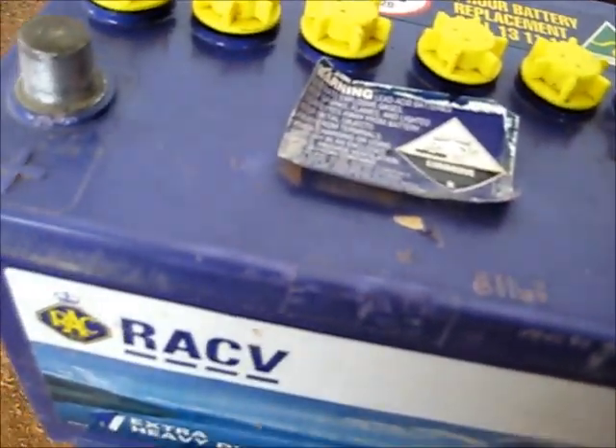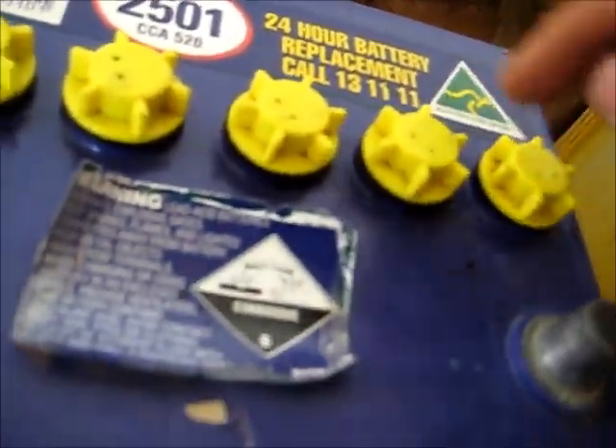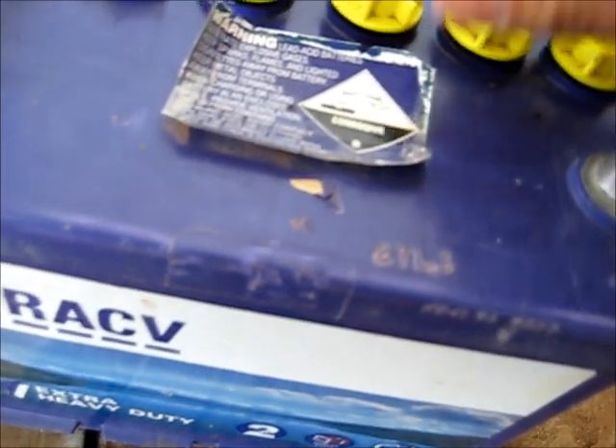That's very hot — too hot for my liking. I think these two cells could be too far gone. I did a test this morning: these came up fair, and these just said recharge. The desulfator's working so far on these cells, but these two are too far gone.